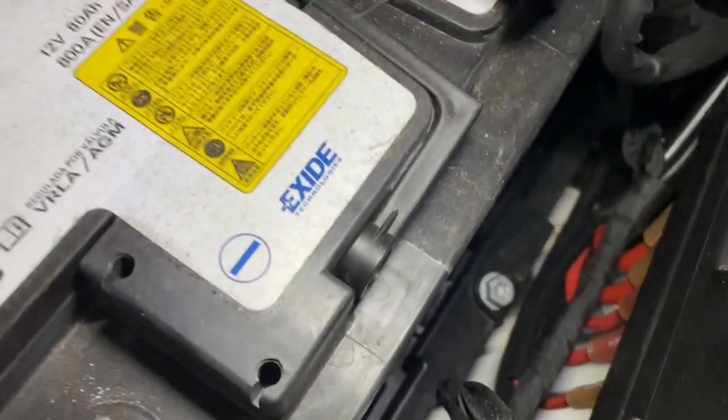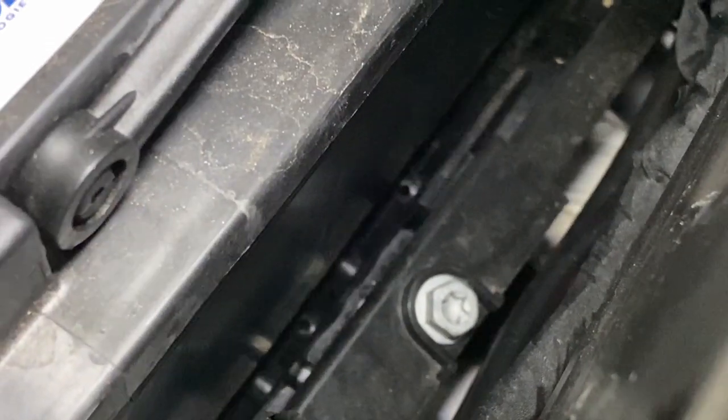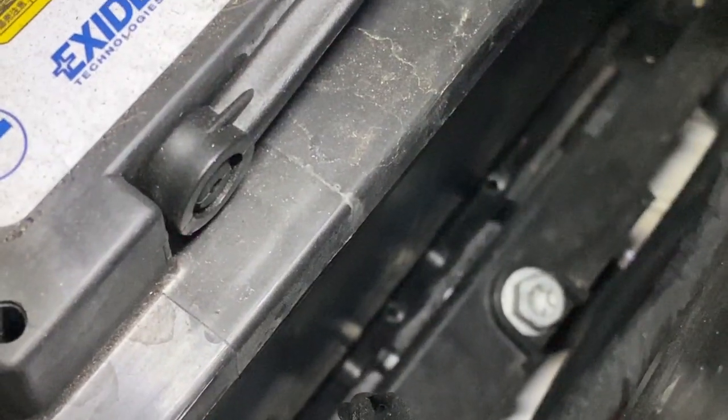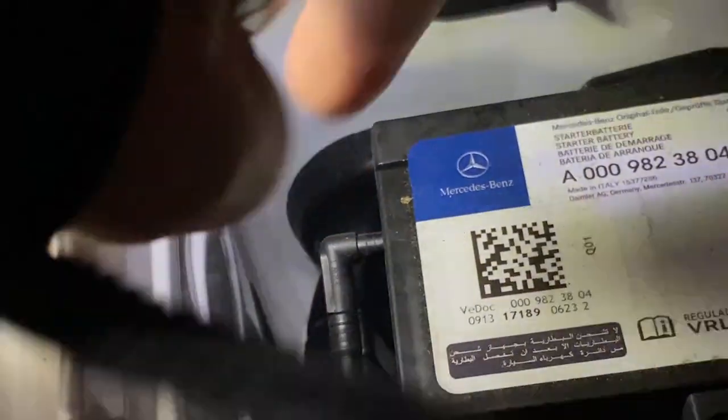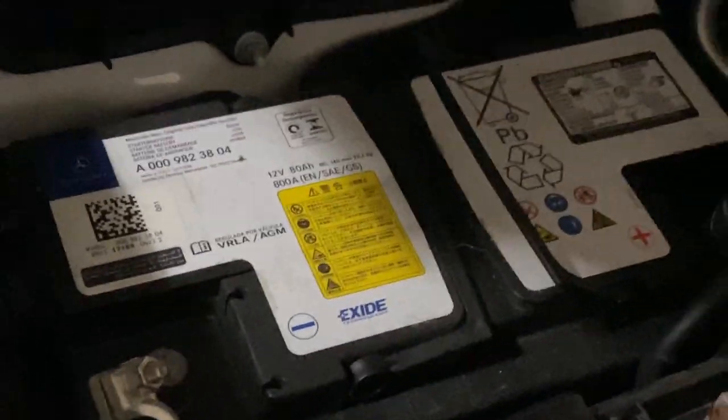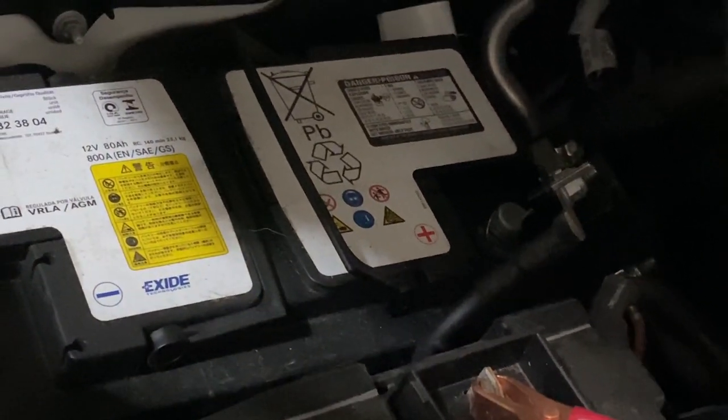I've got the Torx 45 loosened down there, and then the whole plastic bracket on either side just slid back off the battery — that's a really nice feature. I've got both terminals off. I'm going to wrap the positive in some insulated material and use a rubber band to hold it out of the way. I don't want any of those touching ground. There's also a vent hose right here that just needs to pop off the side of the battery on the top. I'll get those terminals out of the way and then lift the battery out.